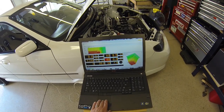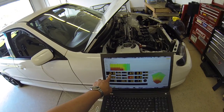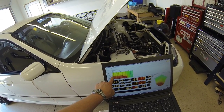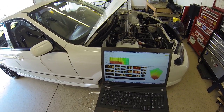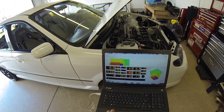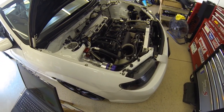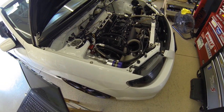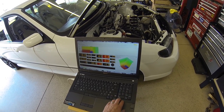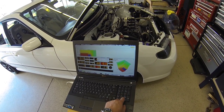The actual map looks like this — the pump stays slow until the temperature goes up, and as soon as the temperature rises it aggressively starts to bring it back. For demonstration, if I select the area right now and set it to five percent, you can see the pump is running at a five percent duty cycle. If I make that 10, 15, 20, 25, 50...